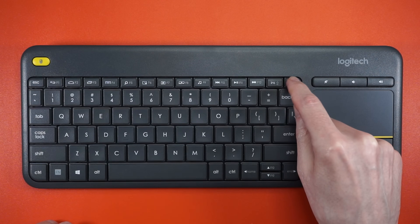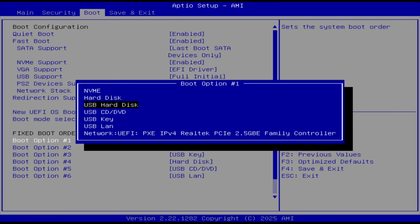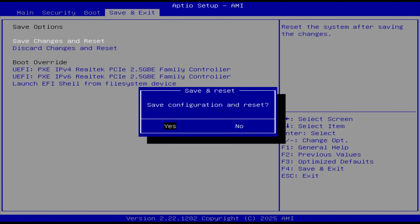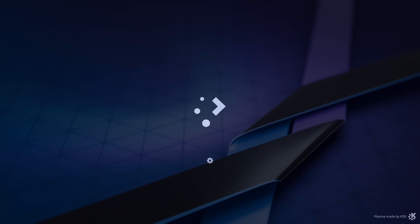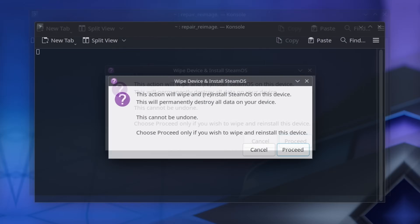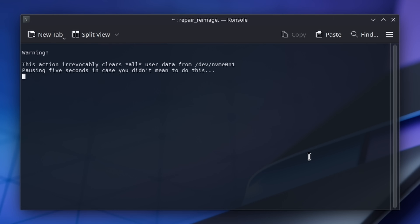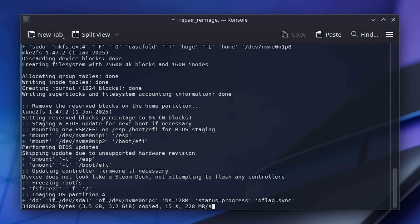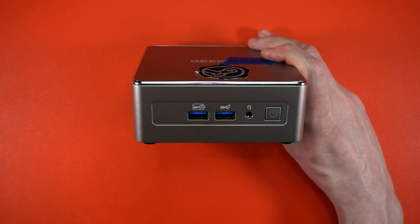Pop in the flash drive and hammer that delete key. It's time to disable secure boot and set the flash drive to the first boot device. Save the changes and let's see what happens. That looks like it's Linux-ing — and look at that, a KDE desktop. Let's pick option 4 and read the warning, because this will nuke the data on whatever drive you have in that NVMe slot. Click proceed and you get an extra 5 seconds to yank the power if you done goofed. Once it's done, click proceed to reboot and scramble to take out the flash drive because you forgot to do it.